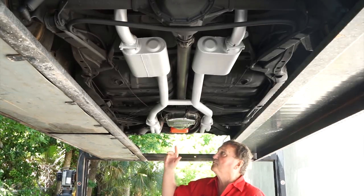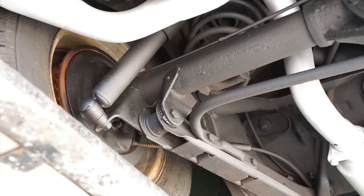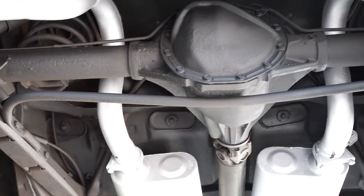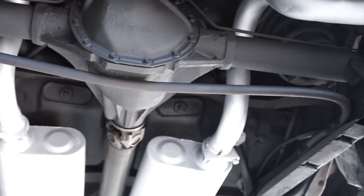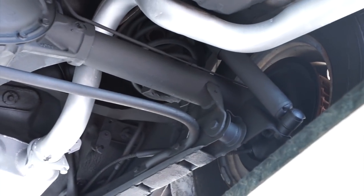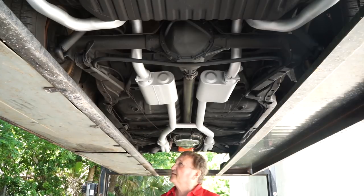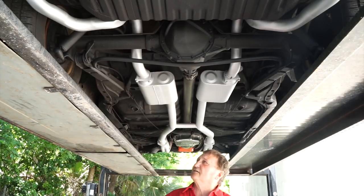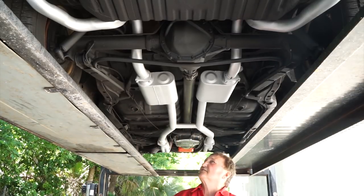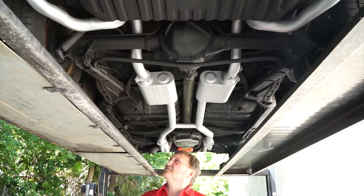Let's see, F41 suspension, the boxed-in swing arms in the back, just the way it would be for an F41. Also, the rear sway bar that attaches to the swing arms with the F41 suspension. Boxed parts of the frame sections, where it transitions off of the C channel back into the box frame, and then back into the C channel again. That's all undisrupted. The structural piece that goes across the top of the frame is in excellent condition.